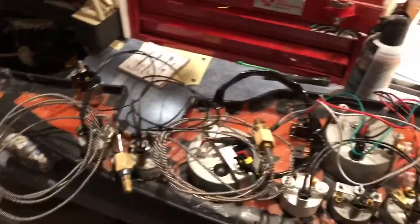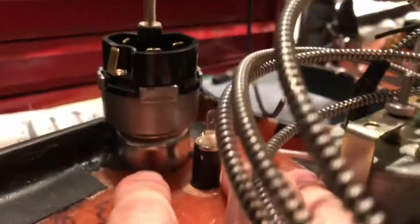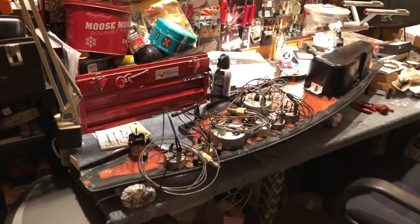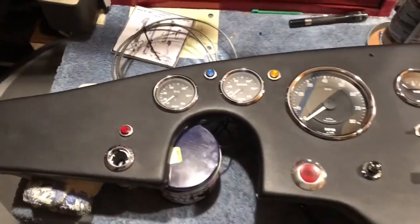Add in the padded vinyl on the other side and that's a heavy five-sixteenths thick — never meant for that. What I ended up doing was trimming down the spring: I cut one complete coil off, and for the spacer cup I cut about an eighth of an inch off and left it a bit rough so it'll dig into the fiberglass really well. Now let's flip this over and have a look.